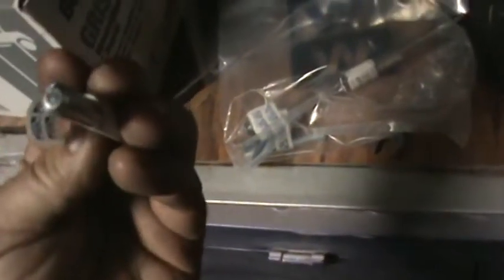I did try to put the hinge pins in Lily, and no go, can't do it. So these are the pins, this is the ream, and here's the one with the threads for the mirror. That's what the pin looks like. And I tried to drive the pin out with the air hammer and it didn't move. So short of ripping the hinge off the door with the air hammer, I'm sure you could beat the shit out of it and maybe get it to move. Maybe heat the hinge up and drive the pin out, I don't know.